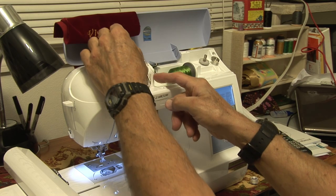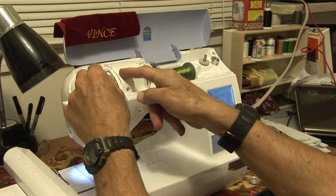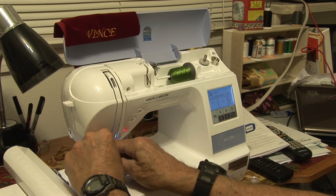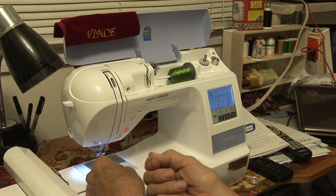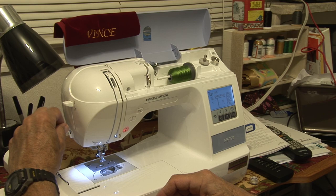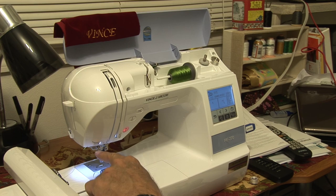Number one comes down, this little deal here, up, the two comes over, down, three, up, over four, down to five, then six is a little metal standoff, like a little finger, and you have to pull the thread and it sort of snaps in. Then you go to seven, which is here, and that leads you right into the cutter for the thread. I just cut the thread, and of course it fell out. It has to stay in that number seven little slot over here.